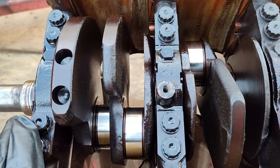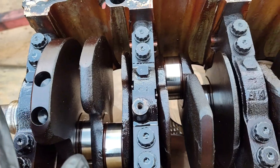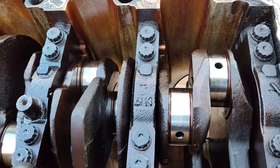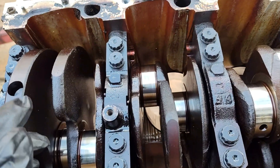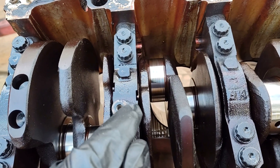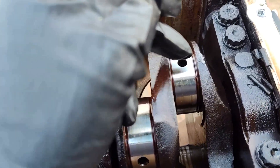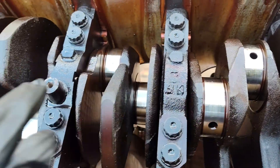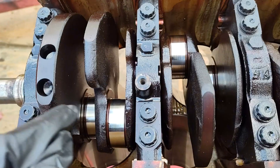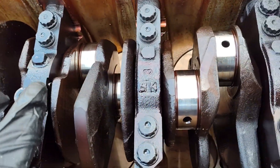Alright, done removing all of these components from the crankshaft — not the main bearings, of course, I'm not touching those. I have found two connecting rod bearings that have some significant wear. These two bearings are not extremely worn out — I'm going to be showing them later on. But this crankshaft looks very good. I have not measured the diameter or out-of-round or anything like that, but as I said before, this engine had no noises, no knocking or anything like that — it was running fine. Remember, the measurements with the right tools are the ones that determine if the crankshaft is good or bad, but only by sight it looks very good, and the engine was running fine anyway.